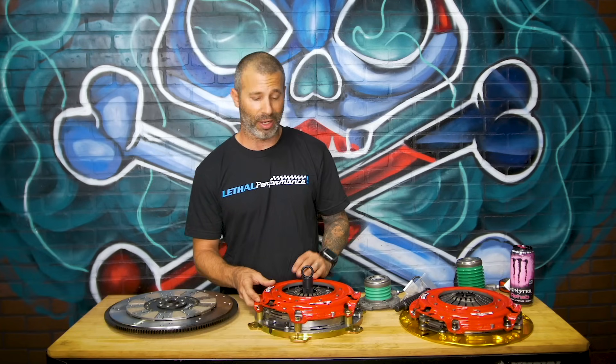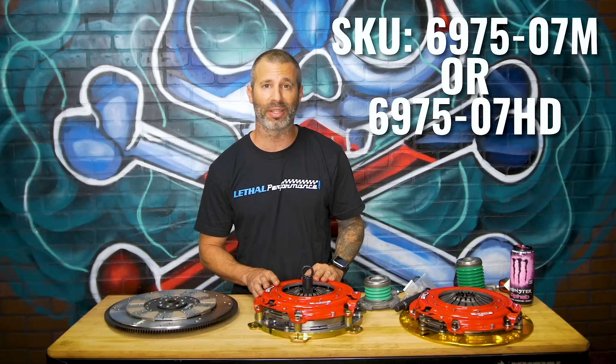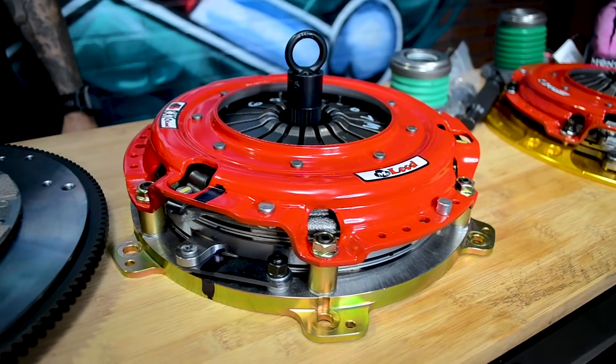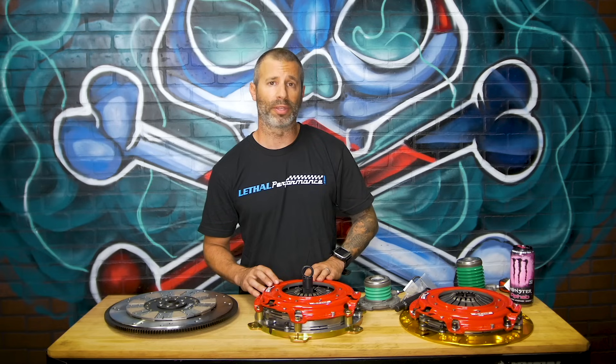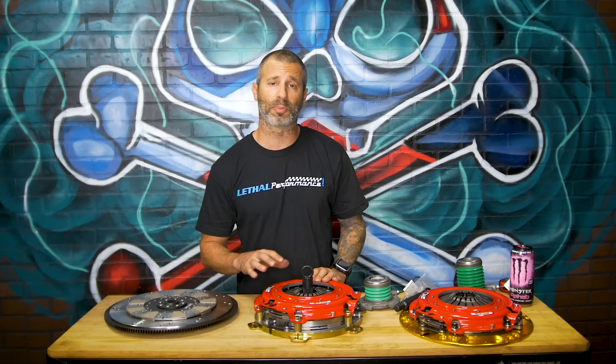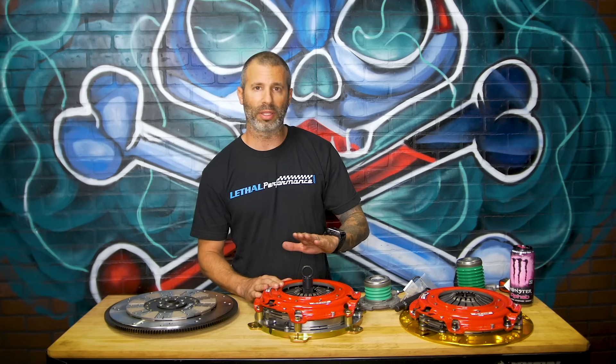Now we're going to talk about the 10-and-up setup. On the 10-14 GT500 that uses from the factory the shorter bearing, McLeod has designed a clutch assembly: the 6975-07M and the 07-HD. The 07M is their standard RXT rated at a thousand horsepower. If you're going more than that or you're going to be really hard on the car, I would recommend going with the HD. The only thing different on the HD is the pressure plate has a higher clamping force. Also very important to know about the 10-and-up McLeod RXT setup is that it has a sprung hub disc, which dampens vibration in the driveline, makes for smoother engagement, and is easier to drive. The 6975 is sprung hub, whereas the 07-09 clutch 6918-07 is a solid hub.